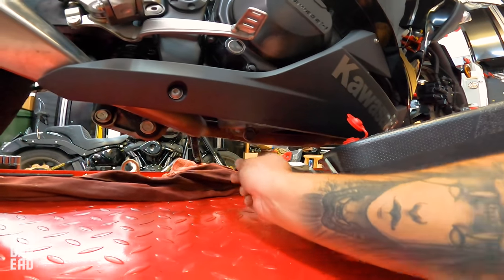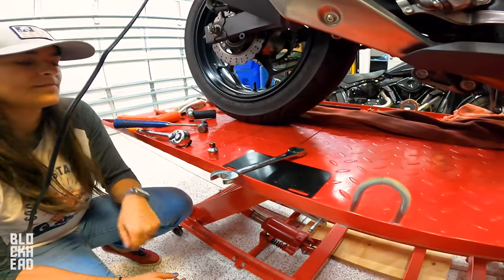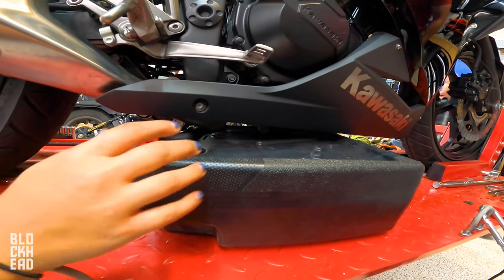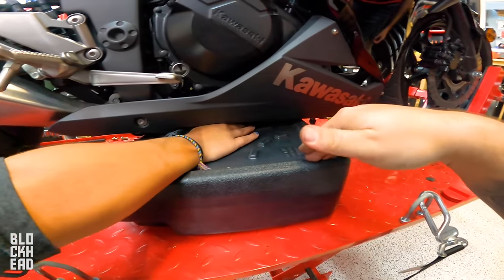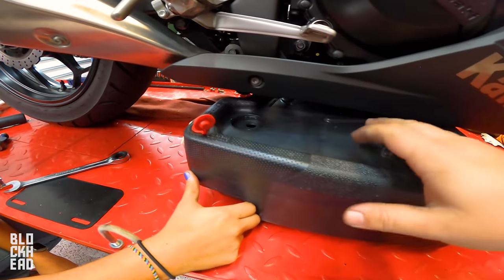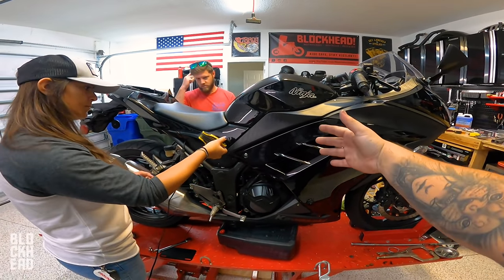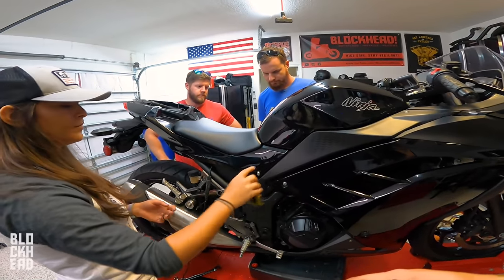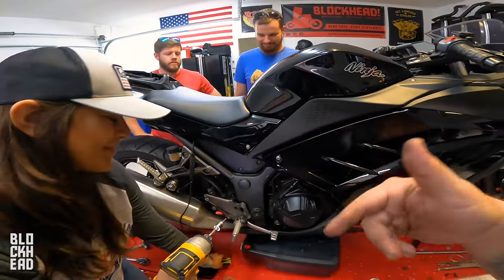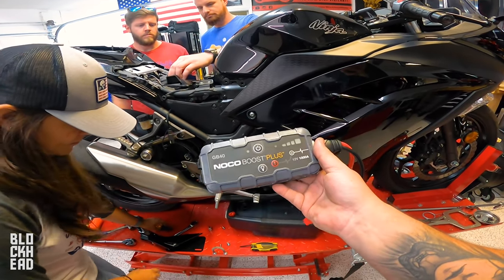Now we're facing draining the oil. We got the bolt for the oil pan which has been loosened, so you can pretty much just take it out with your fingers at this point. But before you do that, you want something under there to catch the oil. Whenever you're using an oil pan, you want to make sure you've got the part where oil goes in open, and this part open — otherwise it'll create a vacuum and just fill up the pan part. Before changing the oil, you want to start the bike up and let it run for a little bit so it warms up and the oil flows more smoothly.